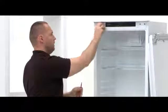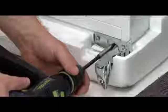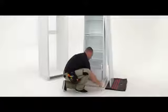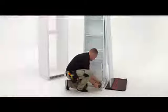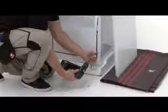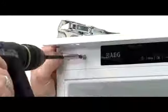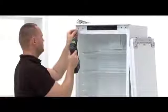Now remove the plastic inserts on the top left. Remove the door hinge, washer and two screws from the bottom right hand side. Place the washer then the hinge into position at top left and screw in with the two screws.